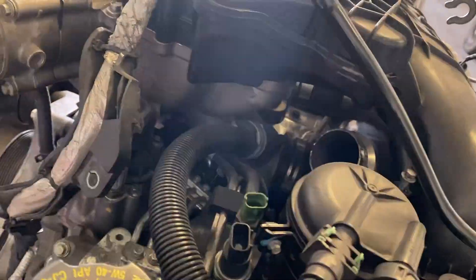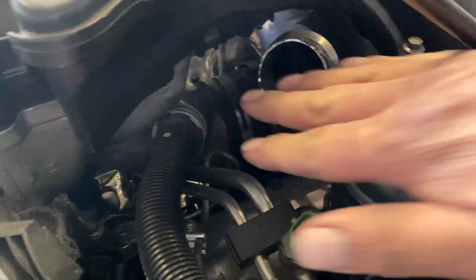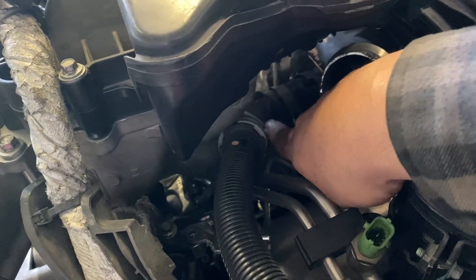Right down there is the intake of the turbo. This is the discharge side of the turbo — the big hole exposed right there. This right here is your discharge going to the charge air cooler. And this right here is the inlet side going way down there — that's the inlet of the turbo.